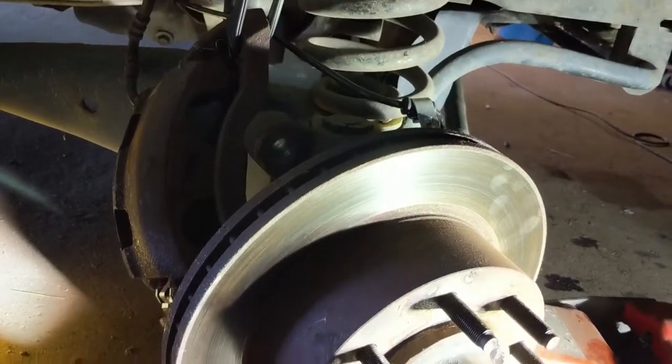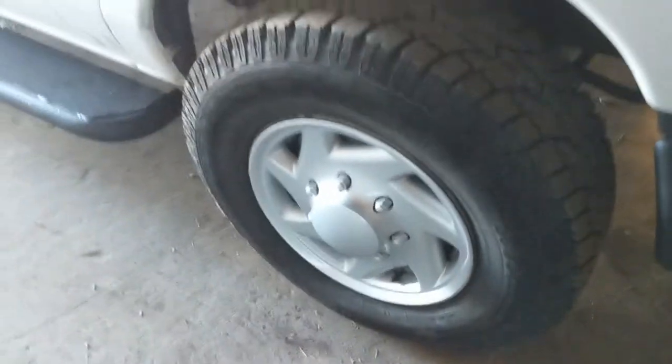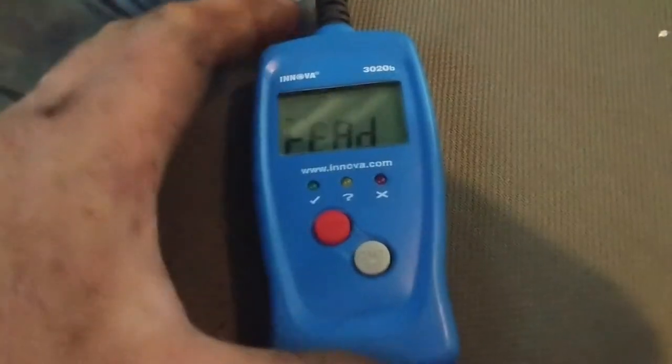I'm going to go ahead and throw back on the caliper assembly, the wheel and the cap, and we're going to turn this back on and see if our ABS light goes out. She's all back together, and there's our new hubcap from hubcaps.com — quick shout out to them, it fits great, looks great. The parts we bought for this van were all from rockauto.com — great spot to buy your parts. Now we can either leave the code in there and hopefully the computer clears it once it sees the new sensor is installed, or we can clear this code ourselves. I'm going to try clearing it ourselves because if there's still a problem, it'll just come back. I'm just going to do this read — it was pretty quick last time. When it comes up with the error, this has a little clear code feature that you can take the code out with.